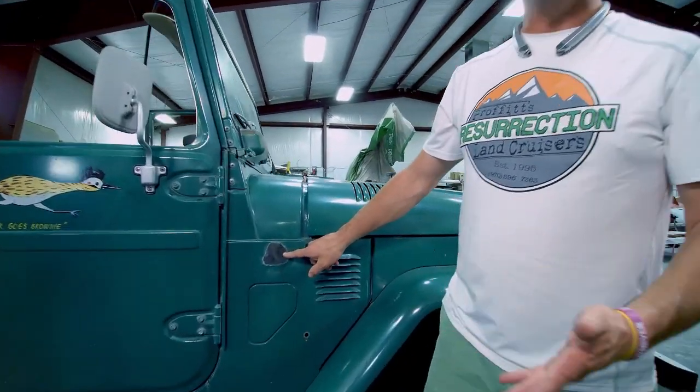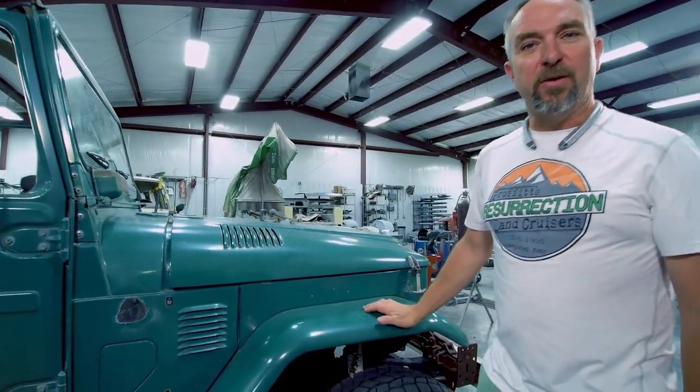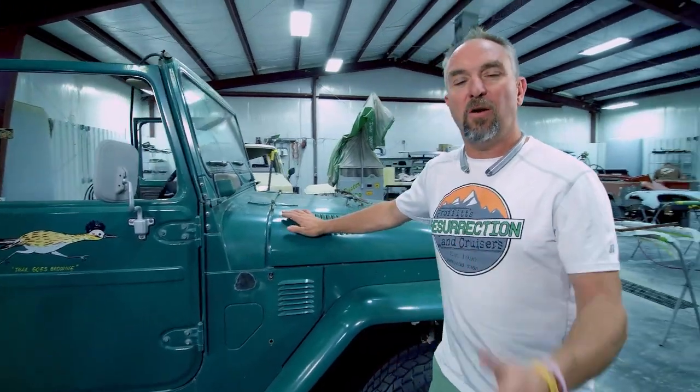It's so hard to figure out when to draw the stopping line. There was an extra antenna here and another on the other side, so now we've got to fix and refinish the rear of the vehicle, up through at least part of the cowling. Then there was a rust repair on the fenders, an extra hole in the hood, and the paint is almost completely worn off the wiper motor cover. Where do you stop? The next step becomes an entire vehicle paint job, and while you're at it you might as well refinish the underside — and while the body is off you should remove the drivetrain and powder coat the frame. We really try hard to work with you on a good stopping point, but keep in mind there isn't always a great one.